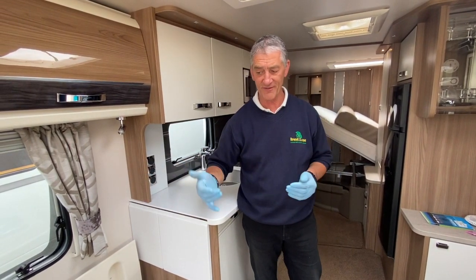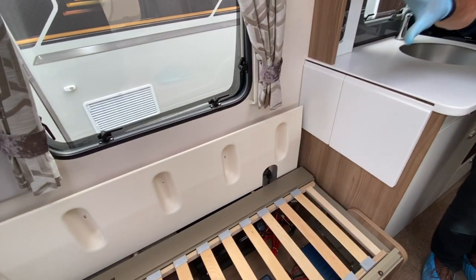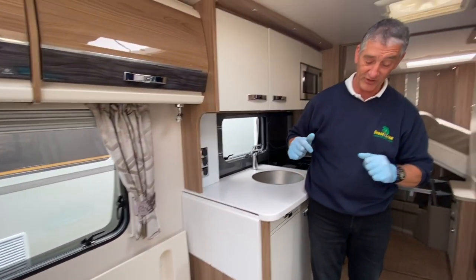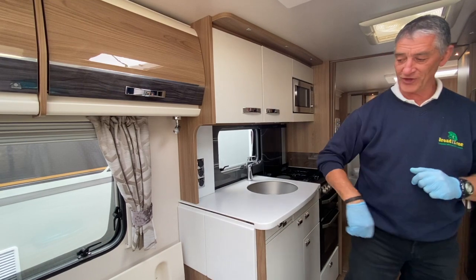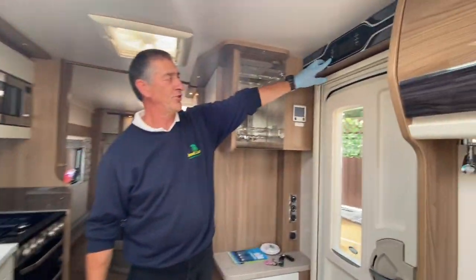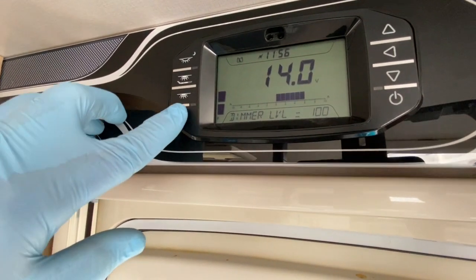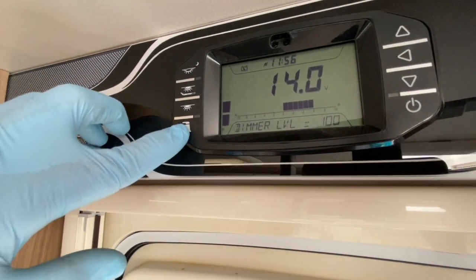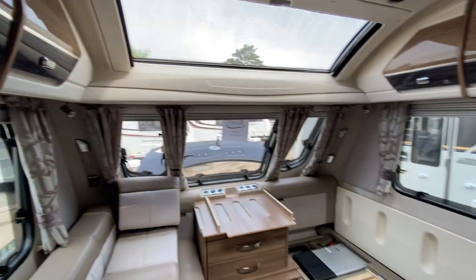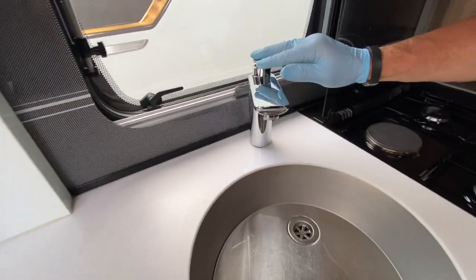I'm using an outside source. There are two connectors on the outside of the caravan — one serves so the aqua roll feeds directly to the kitchen tap, which is the one I've selected. I'm turning the pump on via the tap symbol on the control panel, making sure all drain-down taps and kitchen taps are closed. The pump runs and builds up pressure — now it's gone silent.